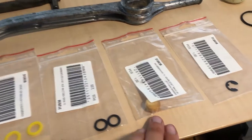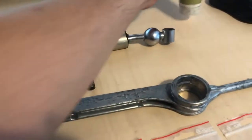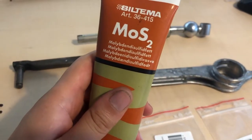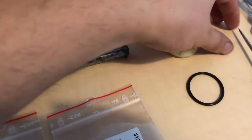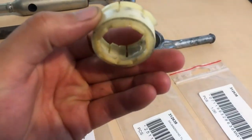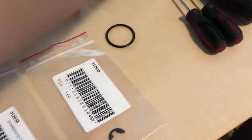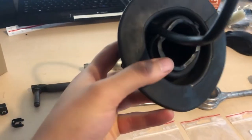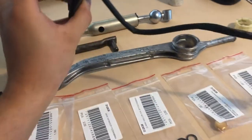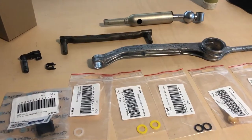I bought a new bushing that goes into the arm, new washers, O-rings, a new foam pad, and clips. I also got some MoS2 molybdenum sulfide grease. The cup is cleaned up fairly well and the O-ring will be oiled a little bit. The boot has a small hole in it — I think I'm gonna glue it up, but other than that it's in nice shape. The wiring is also in nice shape. Let's go ahead and start putting this together.